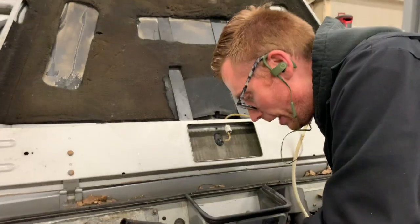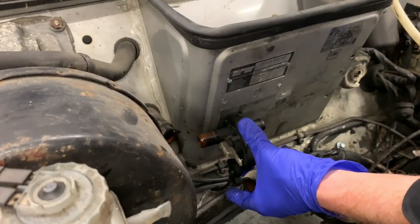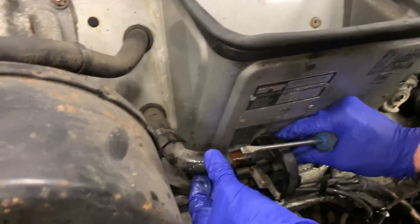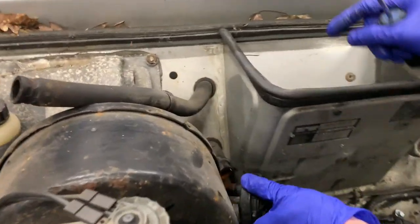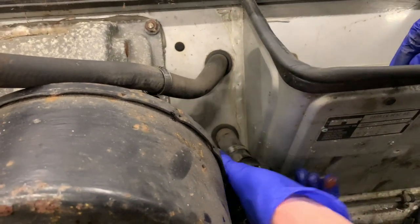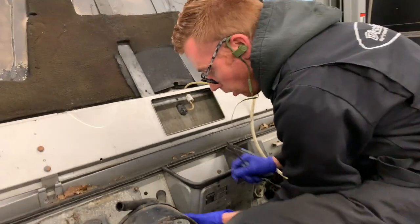Nice. This is your turning on and off switch for your heating, and it's normally mounted right there, and that is in the way, and this little bit of pipe is what connects it. So take a sharp knife, chop through there like I have, get rid of that bend, and then push this round the corner like that and into this space here. And by doing that, you make room for the cylinder head to be able to go all the way back.